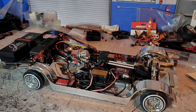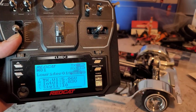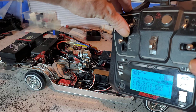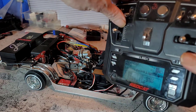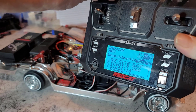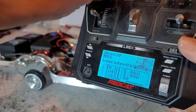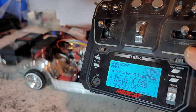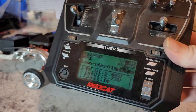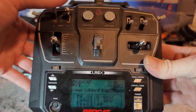It kind of looks like everything works until you start hitting the switches, and then you start having these brownouts. What ends up happening is because the amp load from hitting the rear servos — there are two of them — the amp load on the two rear servos to lift all that weight is more than the ESC can handle. What happens is a brownout: it trades the amp overload for voltage, brings down the pack voltage, and it hits like a low cell cutoff. After a couple of seconds it'll come back — the voltage goes back up and then it seems like everything is okay.